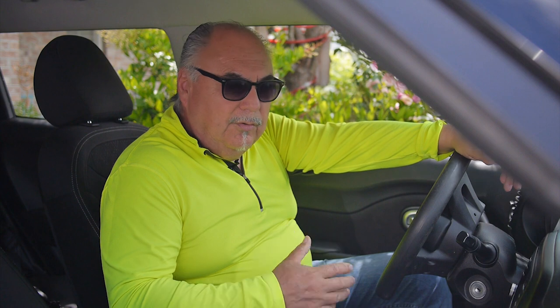Today I'm going to talk to you about your air conditioner and your Kia Soul. Have you noticed when you turn it on that the air doesn't blow like it used to? Maybe you only get half the power? Well it could be a couple of things, but before you take it to your air conditioning guy — they're going to charge you an arm and a leg, minimum 75 to 100 bucks just to look at it — there's something you could do yourself. It costs anywhere from 10 to 20 bucks and doesn't take any tools. It's your cabin air filter.